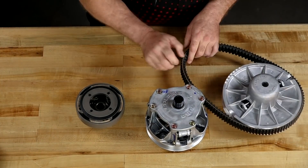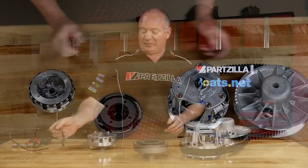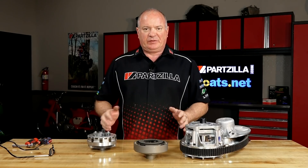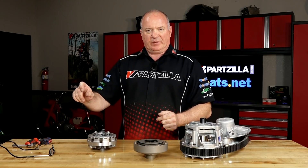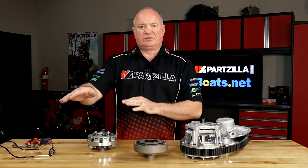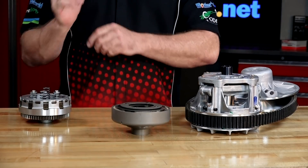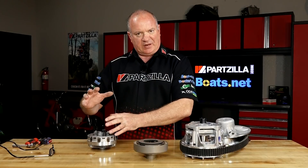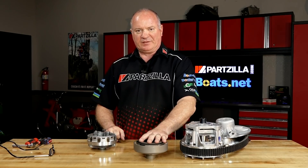Which system do you have on your machine? Well, it depends — some may have more than one. For example, just about every Honda TRX utility machine uses both the disc type and the centrifugal clutch in tandem. They use the centrifugal to stop your forward momentum so you can sit there and idle; you engage the throttle, it makes the clutch spin, and then you start moving. But for shifting gears, they also incorporate a disc type clutch. When you push that shift lever down, it actuates these springs, disconnecting the crankshaft from the transmission, allows it to shift, and when you bring the shifter back up it re-engages — but you won't move yet because you haven't given enough throttle to overcome the springs in the centrifugal clutch.